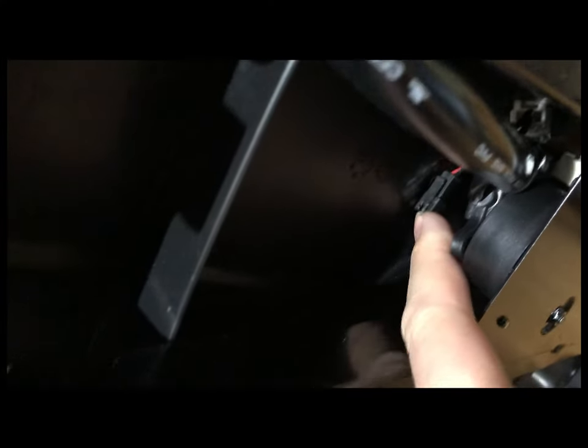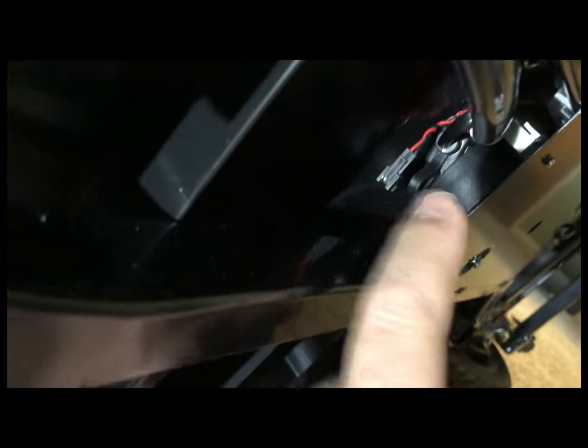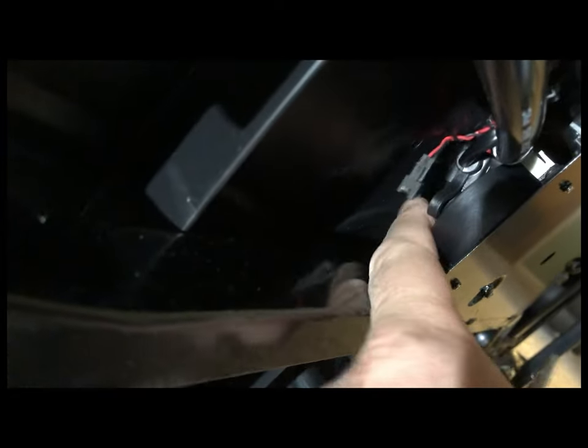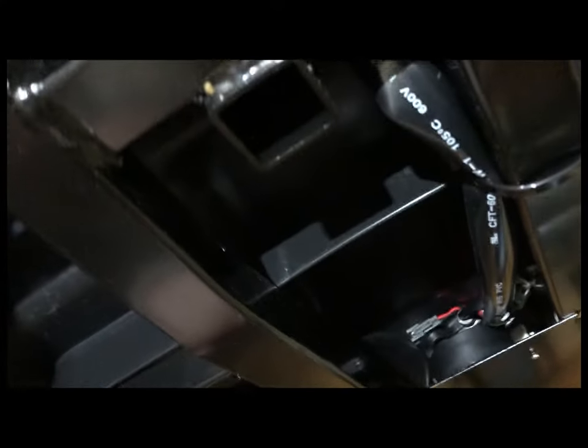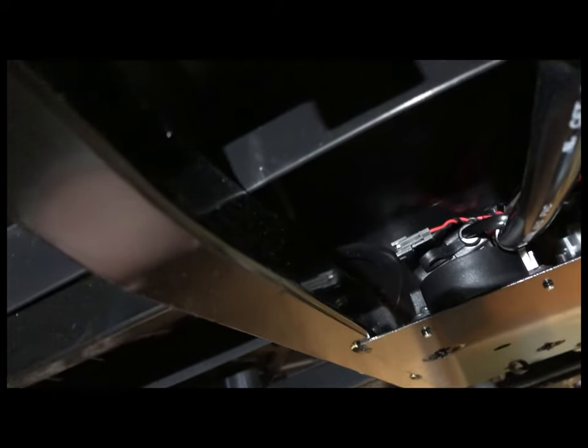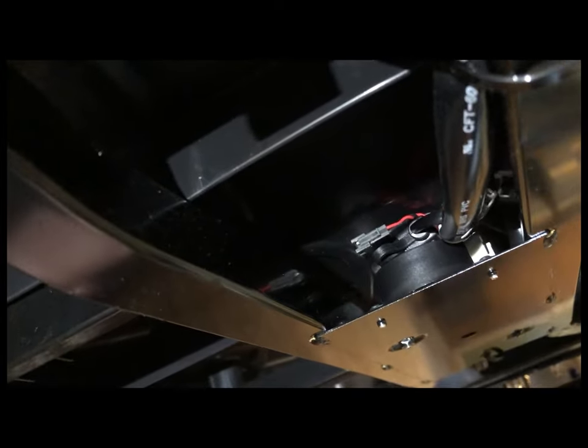You can see this wire here that's disconnected — this black and red. That's the wire for the speaker which I've already disconnected. It's in this harness back here, but you probably won't be able to reach it from here. If you can, you can disconnect it without damaging it that way, or you could follow this disassembly and do it this way so nothing gets damaged.